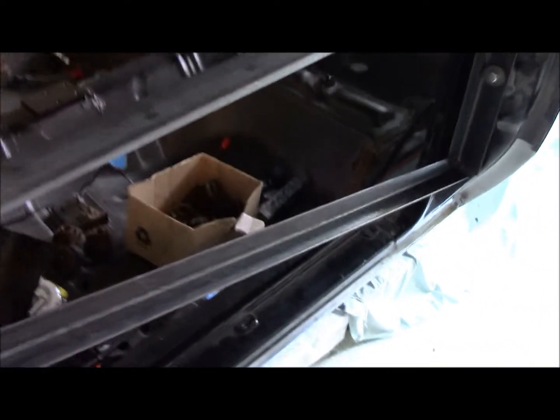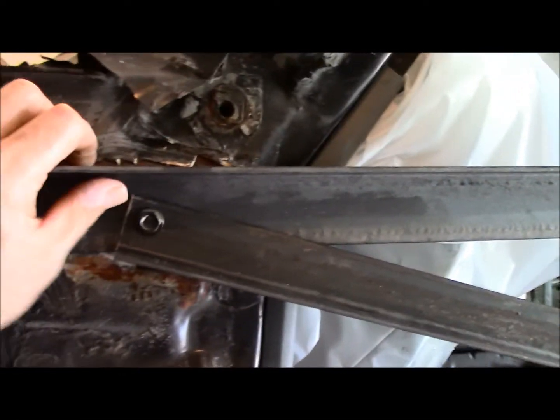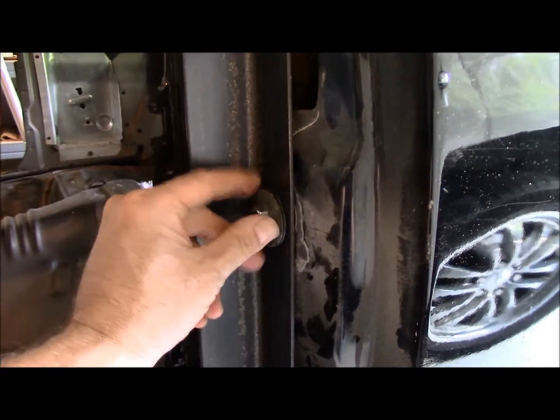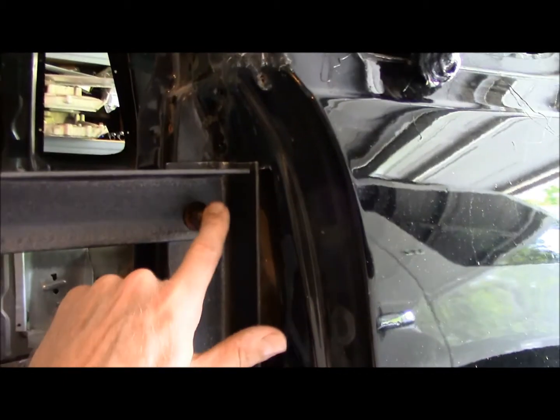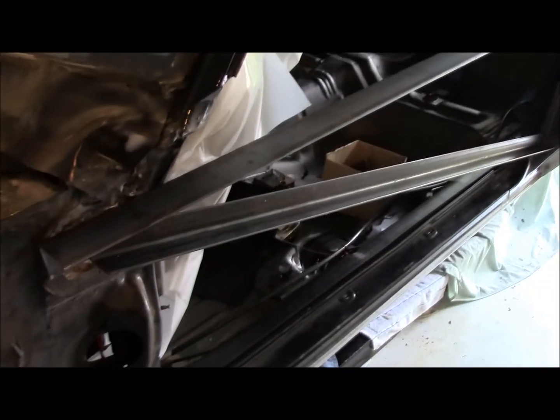Here's what I've come up with for bracing the door openings since I have the doors out. I've just used some angle iron — went to the top hinge bolt on the driver's side, and then I made a plate, took out the striker, drilled the hole, bolted it in at the striker, and then just attached it at both ends. Essentially the same thing you see when they tack-weld to the inside of the body. I've created a triangulated point to brace the body so when it goes up onto the rotisserie, I don't get any body flexing or anything weird.